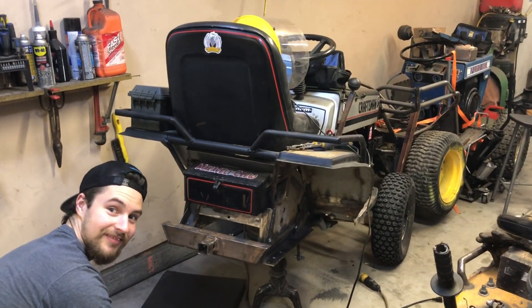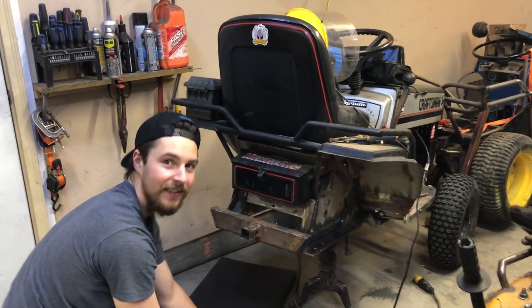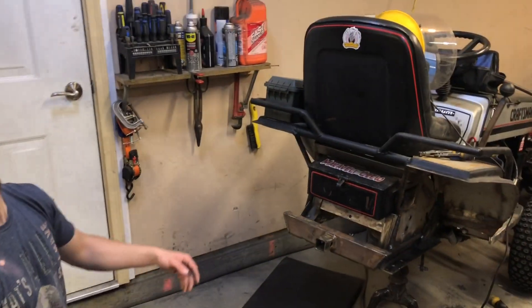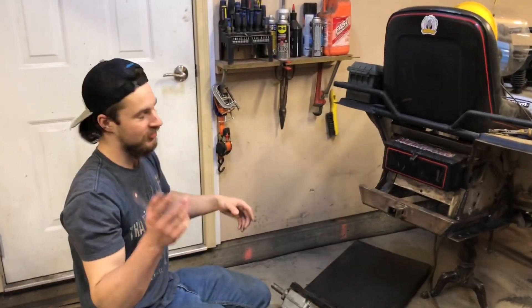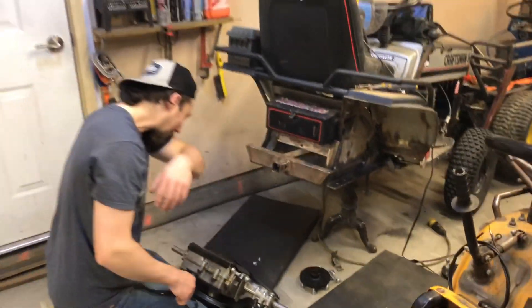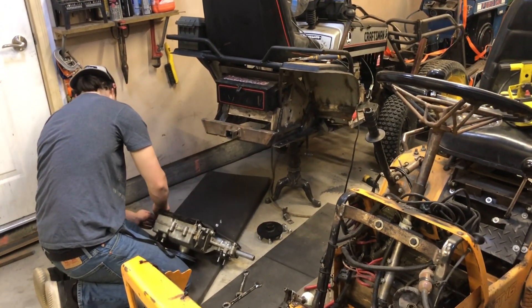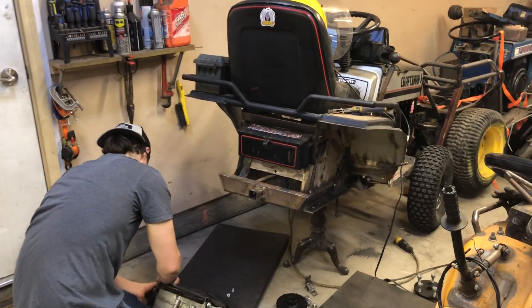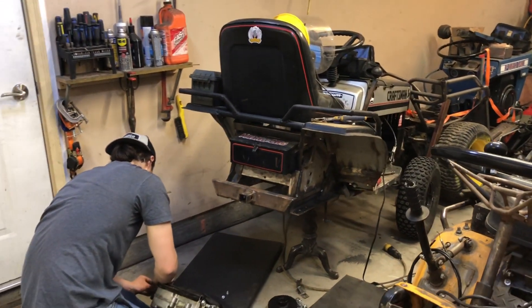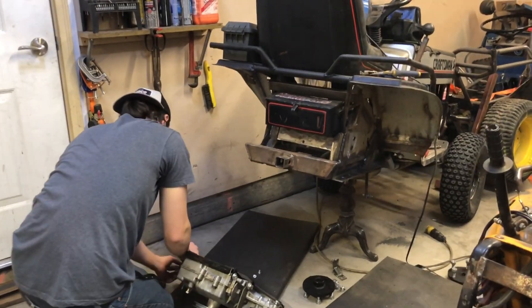...brake — do we want to make it hydraulic brakes? Yeah. And the third is the shifter — I don't know why I forgot that, Tony's been smoking too much I guess. So: brakes, shifter, and clutch slash belt. The clutch should be already done cause we built that previously but the belt is obviously shorter because we stretched it three and a half inches.